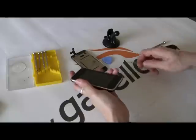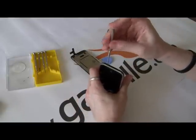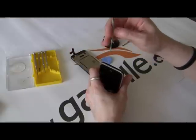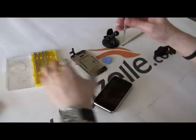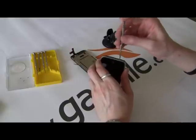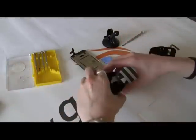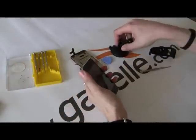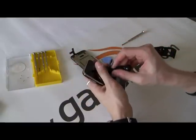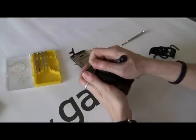Now we're going to do the same thing with our other one. We'll use the Phillips head screwdriver again and take these screws out. This is actually my friend's iPhone and the bottom of the LCD panel was unresponsive, so we're going to switch it out with a functional one. You can buy the LCD and digitizer already put together — they're about a hundred bucks or so on eBay. We're going to lock the suction cup in place and then pull from the bottom, from the home key.